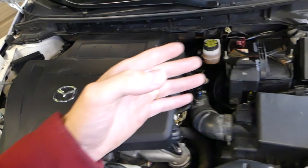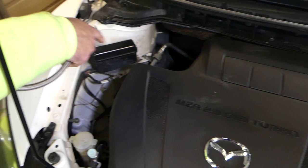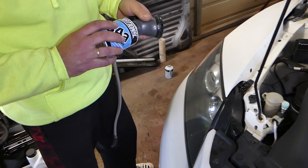We're going to turn the car off now. Always turn the car off if you need to add a second can, so the engine is not turning and you won't hurt yourself. Disconnect the hose and change the can. Always wear gloves and eye protection. Some refrigerant will always leak out, so preferably do this outside — you don't want to breathe that in.